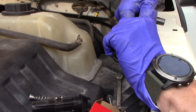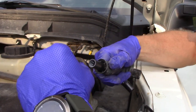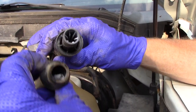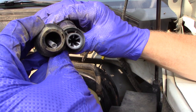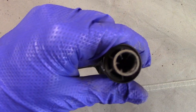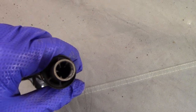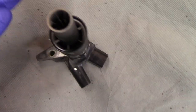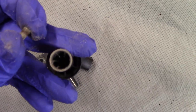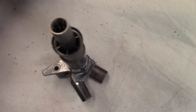I'll pop the old one off — it just pulls off like that. If you look down in there, there's a decent amount of corrosion going on inside. I'm going to blow it out with some air and try to clean it up a little. You can see that some of the ribbing down the sides of the inside is completely corroded away. I'm not sure if this coil pack is going to be salvageable, but I'm going to use some water and baking soda to try to flush out all the corrosion, clean it up the best I can — maybe use a pipe cleaner to get down in there — and put it back together to see if it fixes the problem.